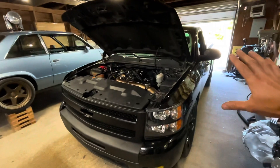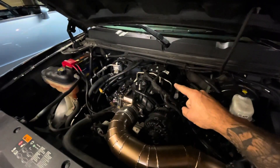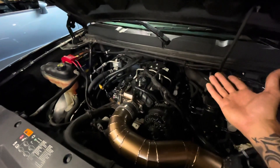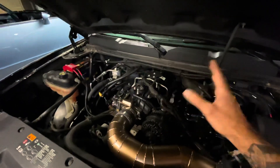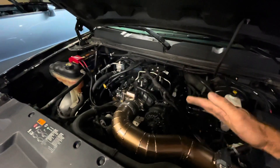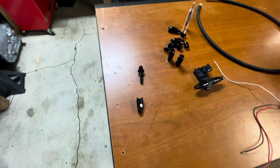I'm going to show you all the things that I bought in order to make this happen. So first off — 2012 Chevy Silverado, it is meant to run on E85 right off that virtual sensor. But because I'm switching over to a physical sensor, I have to put that physical sensor in the system somewhere. I'm opting to do it right at the rail — I'm going to tap into the rail where the feed comes in, because this is a returnless style. That's really the only place and the easiest place in my opinion. Some people debate that you should put this in the return side, but that little bit of fuel in there might be a little bit of a mixture between E85 and whatever gasoline you're running. I don't think it's going to hurt the engine because that's why you have knock sensors — it's going to sense the knock and retard your timing and correct itself. So basically we're going to tap into the fuel rail.